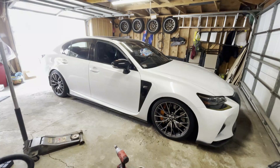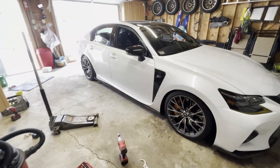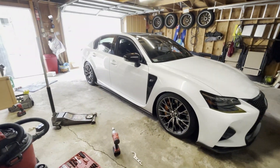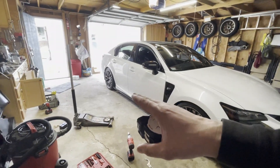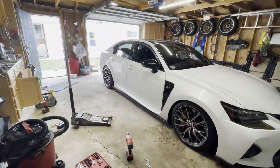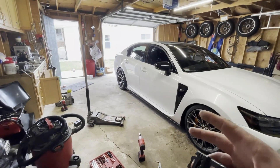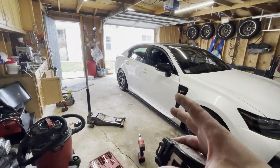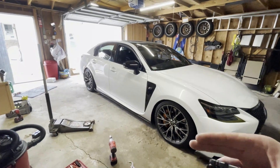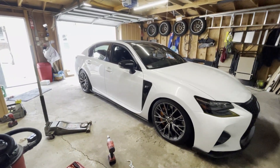So far I've driven around the block and it feels very good — the front end feels good and the back end feels way more planted. The dampening is currently set at 7 clicks from softest on both front and rear to start on the softer side, so I have way more room to go firmer. I'll keep you guys updated. Subscribe and peace out!